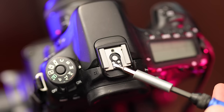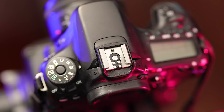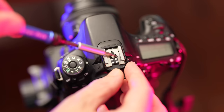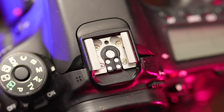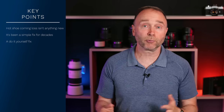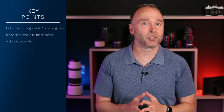This is the Canon EOS 70D, my camera, and I've never done this before. And once I found my glasses, this became very easy to do. All I needed was a small slot screwdriver to remove this small metal plate. And once I finally got it loose, it requires a little bit of wiggling from the center to the bottom, and then on the other side. And once you've gotten it out of the way, simply use a Phillips bit to tighten. That's it. And if you've been shooting for decades and you've had something in that hot shoe most of that time, you've probably encountered this problem — that hot shoe coming loose — and with a simple screwdriver, it's easy to fix. No fuss, and very little real risk of damaging the camera.